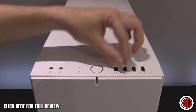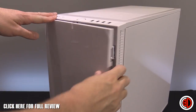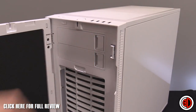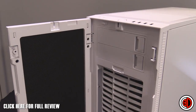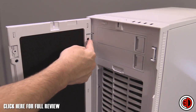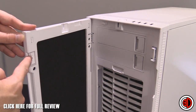We've got two USB 2s and then two USB 3s. When we swing the front door open, the door itself is new compared to the R3 and R4. It has hinges on either side, so you can now have the door open whichever way you like. Just unscrew the little tab at the top and bottom and you can swap it over and fit it onto the other side.